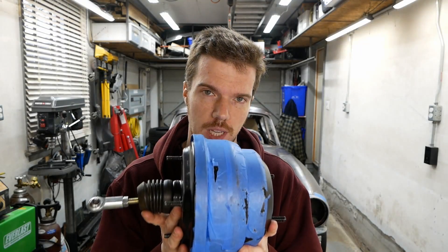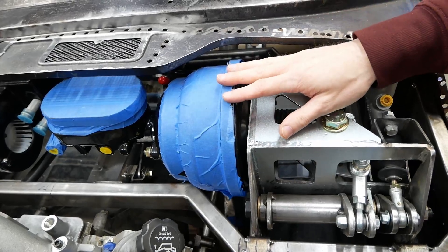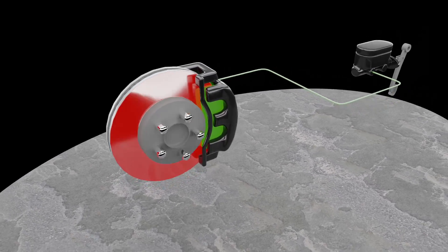This creates a lot of friction and will turn the kinetic energy of the car into heat, which eventually will slow you down to a stop. It's a simplified look at the system, but one other component worth mentioning is the booster, which sandwiches in between the pedal and the master cylinder and makes braking easier. Pads are available in various sizes and types of friction material, and discs can be small or large, vented or unvented, cast iron or carbon ceramic. But in all situations, the harder you press on the pedal, the harder the pads get clamped against the disc and the harder you stop. Some of the math needed to set all this up can be a bit hard though.